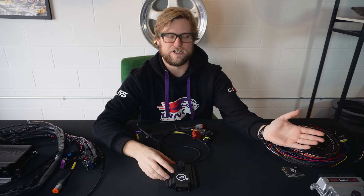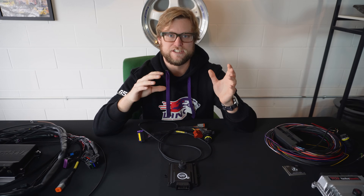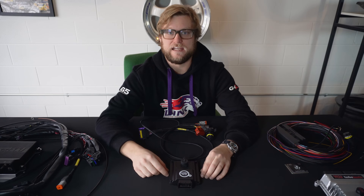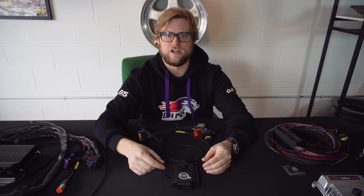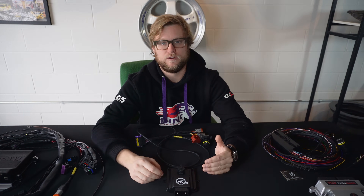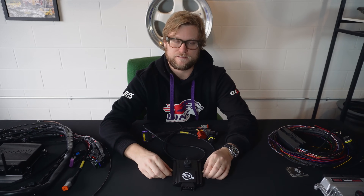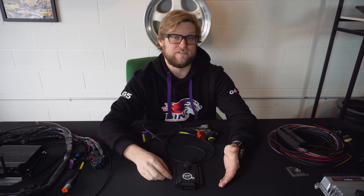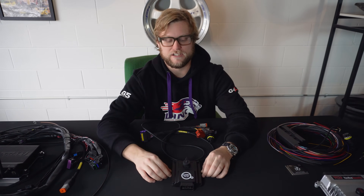Let's say you have an F80 DCT. If you put it in your car, that F80 DCT is still going to think it's in an F80, and you're just mimicking the environment and altering it to essentially tune it a little bit, and also keep it happy and not throwing codes. Or say you have an 8HP from an M55 car and you want to put it in your M54 car — you're going to use a Can TCU. You can also upgrade the transmission's tune by flashing it, things like XHP, which help it shift faster. XHP has a number of certain tunes built into the Can TCU software, as well as external softwares available separately, which allow you to tune the transmission. A lot of times these aren't even needed because we can alter the environment in ways to make the transmission act how you would like using the Can TCU software.